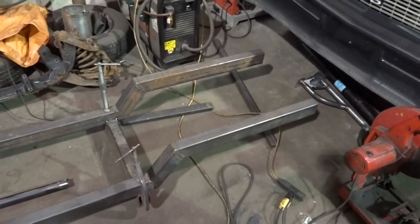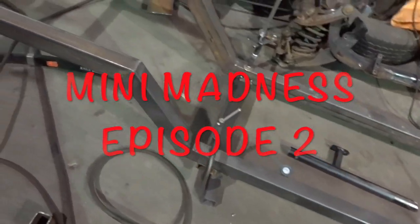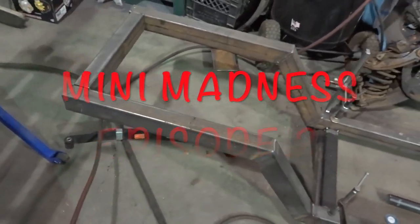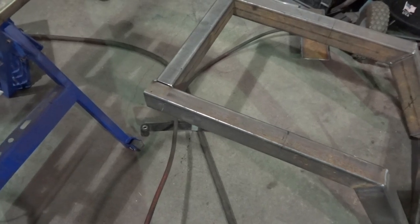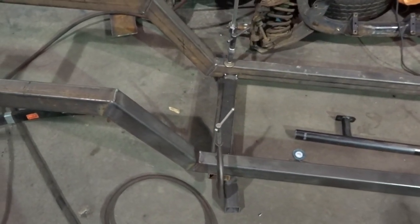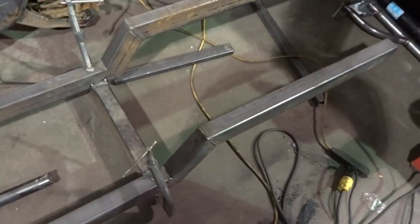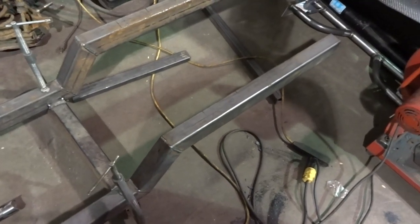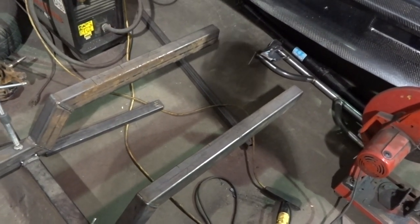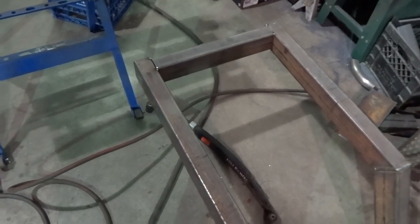Here's the start of the chassis for the mini. I took some rough measurements and left the ends long, so everything's just tacked together. I'm going to make it two inches wider to fit the engine a little better, and then I'm going to notch out the front to make the track width as narrow as possible. The front rails go off into oblivion, the rear rails come back, and there's a crossmember tacked right there.